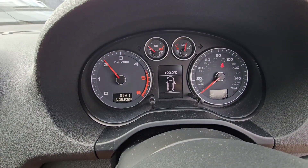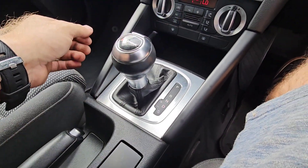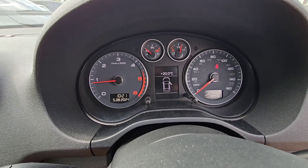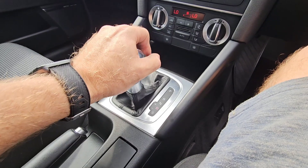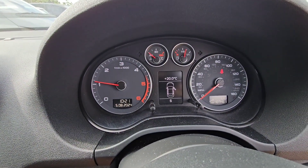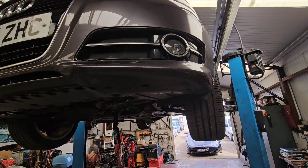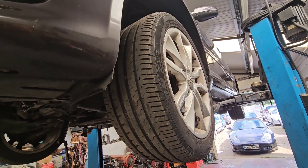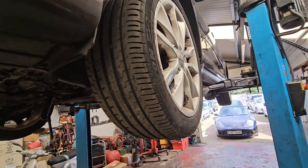So I think it's the mechatronics pump — the hydraulic pump inside the gearbox — which is pretty simple to remove on these, it's just 7 bolts. I'm going to get in the workshop, lift it up and we'll have a quick look. Just pulled the Audi into the workshop. You can select all the gears, no dash lights on. I just scanned it and it's come up with some codes.